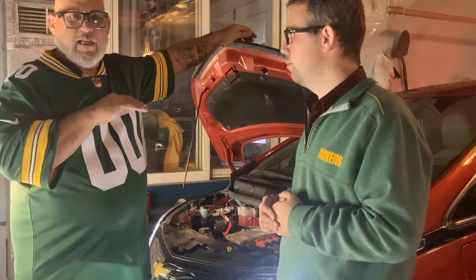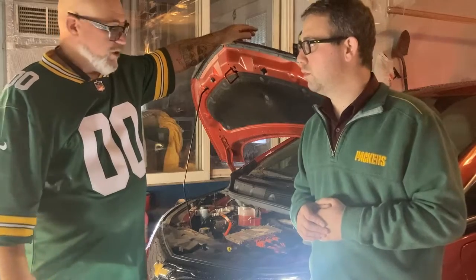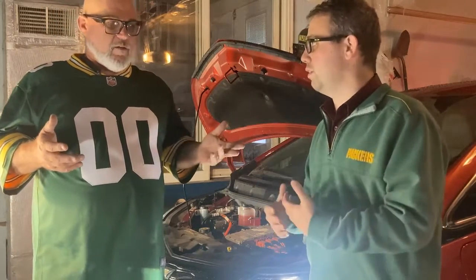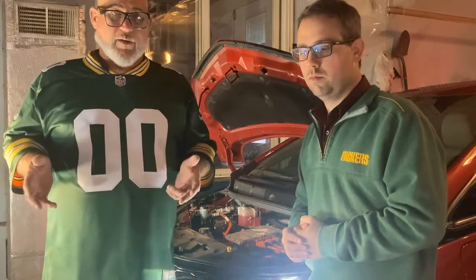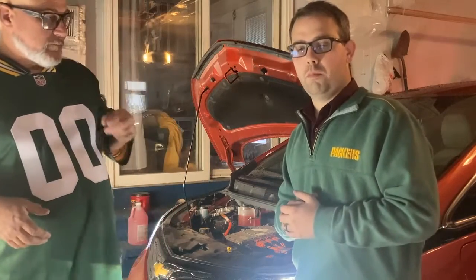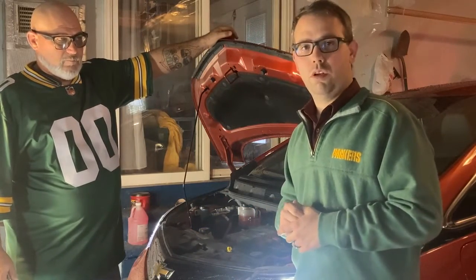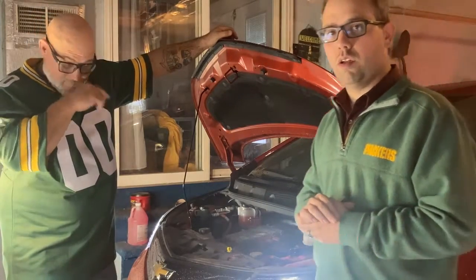You can go up to a stoplight and it'll actually stop your car because it's charging that hard. If you're going 45 miles an hour and come to a red light and slow down, you're going to see 25 to 30 kilowatts being generated — there's a gauge on your dashboard. That's the miracle of regenerative braking, but it means you're not using friction brakes. There are scenarios — like a deer jumping out in front of you on the highway — where you have to hit the friction brakes. My 2010 Ford Focus needed brakes changed at about 90,000 miles. My EV has over 100,000 miles and is nowhere near needing brake pads. My car is at 30,000 and the brakes have practically never been used.